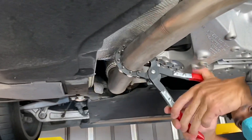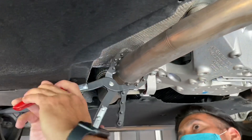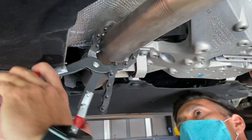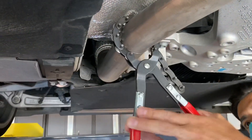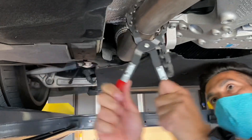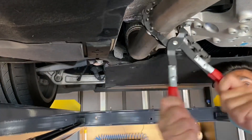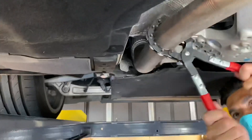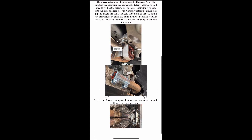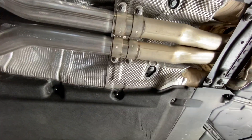We got Yvonne here working on cutting the hangers. If you don't want to pay for the tools to do this, go to your local auto parts store — this is called a tailpipe cutter. You can just rent this or get it as a loaner; you put a $55 deposit down and then take it back when you're done and they refund your money. It'll make a nice clean cut. Your alternative would be a reciprocating saw, which is what's in the instructions, or a hacksaw, which I don't recommend. This works pretty good. This is what it looks like installed — pretty straightforward, just follow the instructions that come along with it.